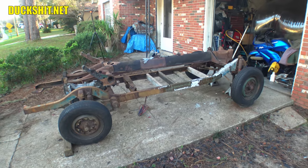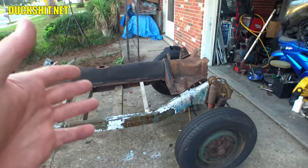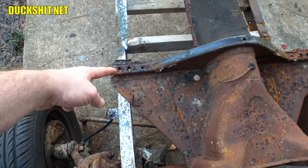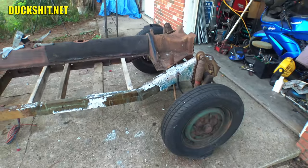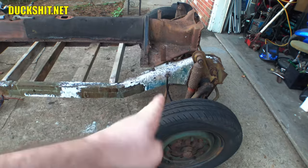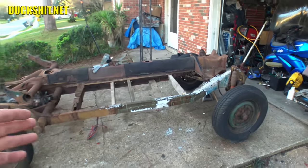It's pretty much about making the body fit for mounting, because obviously this Beetle pan — which may end up being what goes on here — we'll just see what happens when I pull up available parts. But first off, I can see that the frame is not going to clear the edge of the Napoleon's hat here, and that means I'm going to have to cut into the body. But I don't want to cut into the body. So I think if I did put a Beetle body on this, what I'm going to do is re-engineer that 45-degree corner a little bit, bring it down and slope it out so the body drops right onto this frame.